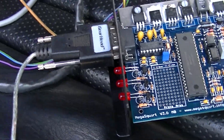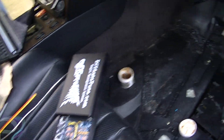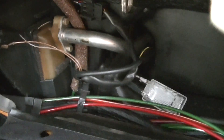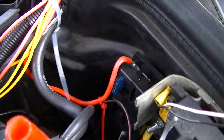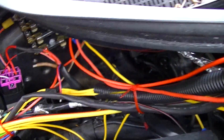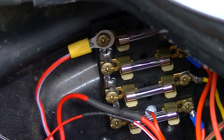And then maybe upgrade to Megasquirt 2. The harness just comes through here — I'm thinking about feeding it into the port here but my heater core is right there and it's going to get pretty hot. I'm not running ignition on this board, I'm just running the EDIS, so that was pretty easy to put in. I have one fuse box right here on this side which controls the fuel pump and auxiliary things that need power, and I have the main relay right there with the other fuse board, which controls the Megasquirt, the injectors, and the EDIS module.